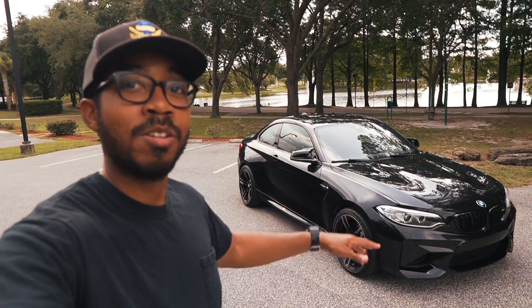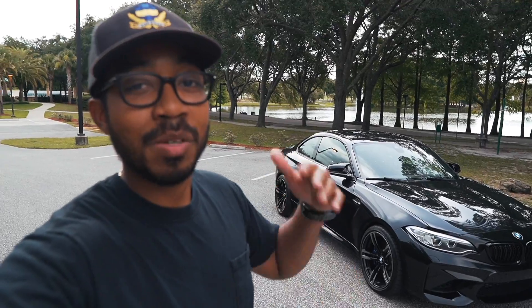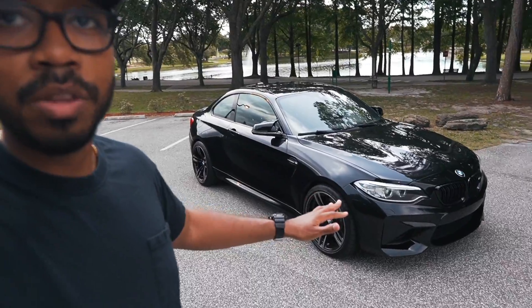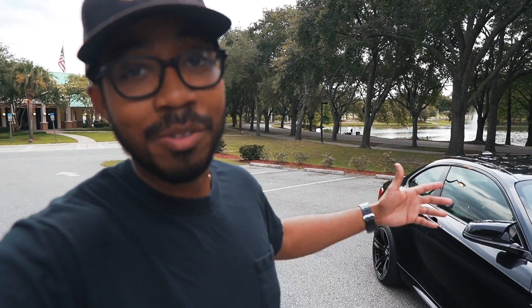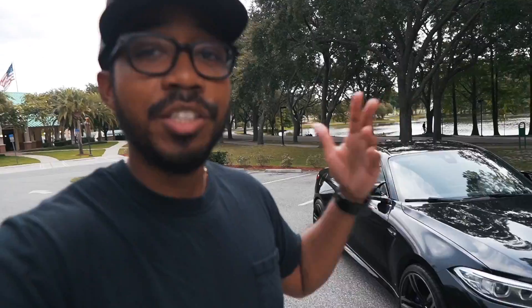And there you guys have it — the stud conversion kit and the wheel spacers are on the car. It looks amazing — super happy with how it came out. Big shout out to Motorsport Hardware for supplying us with everything we needed. Overall, loving how the car looks right now — it definitely has a more aggressive stance. The 12 millimeter spacer on the back is pretty aggressive, and when we do lower the car I'm not sure if it's going to rub, but worst case we'll go down to a 10 millimeter spacer. If you guys enjoyed this install, please give us a like, share the video, subscribe, and tune in for the next video.